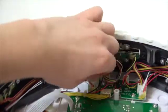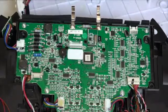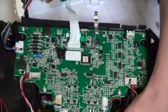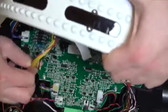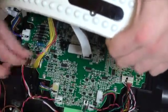To finish off this repair, simply reattach bObi's cover. Attach the all-white circuit plug first. It connects in the center of the main board. The yellow wired circuit plug attaches to the left side of the motherboard. Press each connector firmly until they lock in their holders.